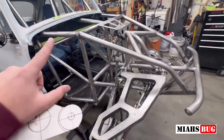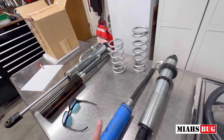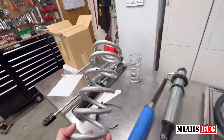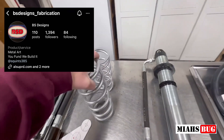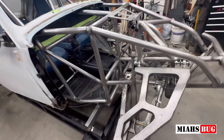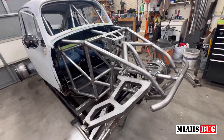This should be a pretty straightforward mod — we'll just be installing the shocks directly in here and adding tabs. The one thing we're going to have to be careful of is the coil over: the coil over and the bypass shock are going to be a little tight. We want to make sure we have clearance between the coil over and the triple bypass of at least around a quarter inch. To do that I had to get some springs — I borrowed these from BS Designs right here in Talladega; his name's Brad, he's a really cool guy. He let me borrow his springs from his truck so we'll be putting those on to make sure we have enough clearance and everything clears properly. First thing we're going to do is cut some brackets and cut that out, then get them installed and start trying to get everything to fit. Let's do this.